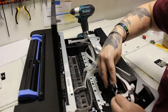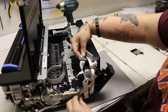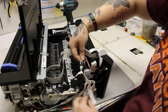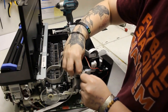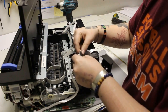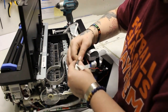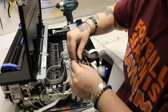There is an iron core that is holding the FFC cables in place and a piece of tape. I had to lift up that piece of tape to loosen the FFC cables, and the main board is at the bottom. I'm taking off the FFC cables that lead to the main board so I can find the ones going to that iron core. I took off one FFC cable and saw it didn't lead to the iron core, so I put it over the top of the LCD panel to get it out of the way. You have to find where the double-sided tape is connecting all the FFC cables, take that double-sided tape apart, and slowly work out the FFC cables through that iron core. There are about three to four cables here — I move the iron core back, take apart the double-sided tape, and pull the FFC cables that lead through.